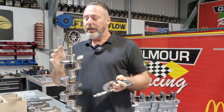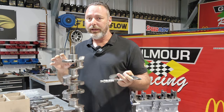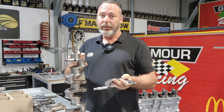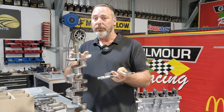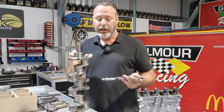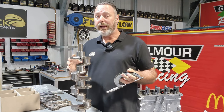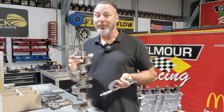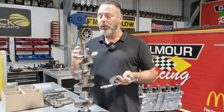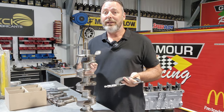This crank's been blueprinted - basically everything put back where it should be to a closer specification than factory. All the piston events are the same period, same stroke on each cylinder, the main journals are straight, and all the rod journals are straight - no piston getting to TDC before another. We want everything to happen at the same time. Blueprinted down to minimum weight. Our bearing clearances are two and a quarter thou - for a road car that's quite loose, but for a race engine it's within the window. We need that extra clearance because it will run hotter, doing more RPM, and we want more oil flow through the journal to keep it cooler.